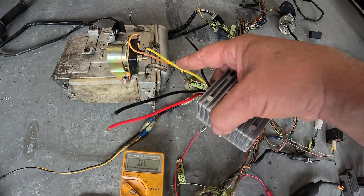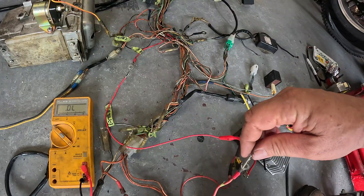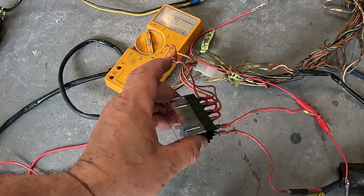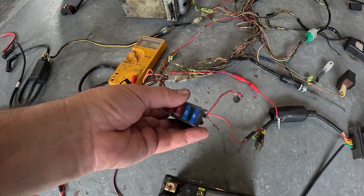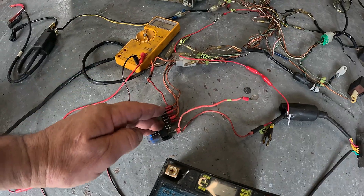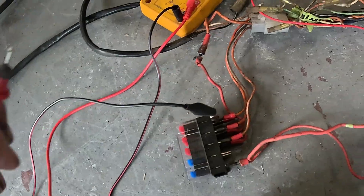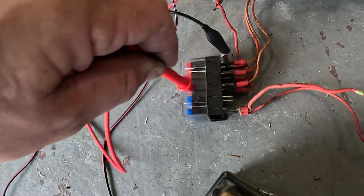It's not going to be hooked to the battery — that's what's going to confuse you. It's going to be hooked to the starter relay. The wire going from the starter relay to the battery is a throwaway wire. It looks important because it's on the fuse box, but this fuse that goes to the starter relay is almost a whole separate system. If you take your fuse box, this side's hot — all these are hot — but not this one. That's the starter relay one.